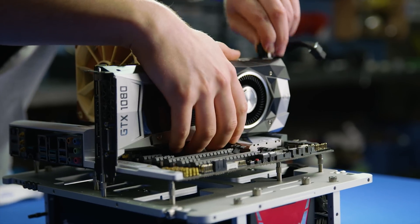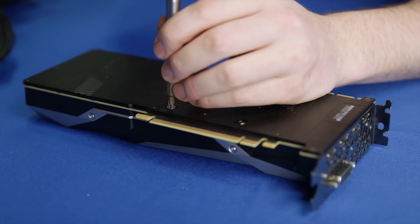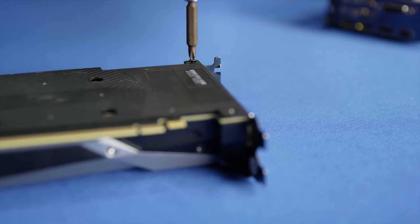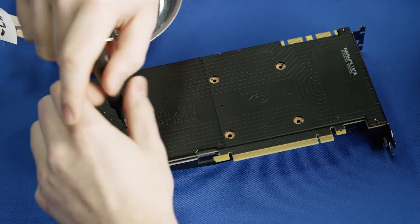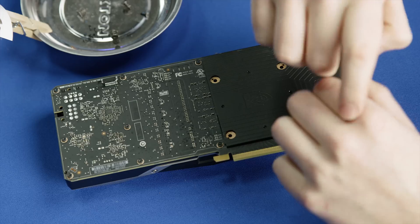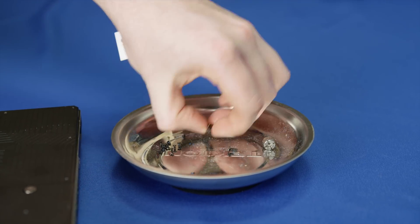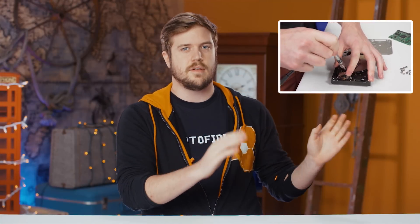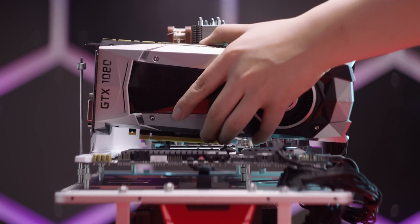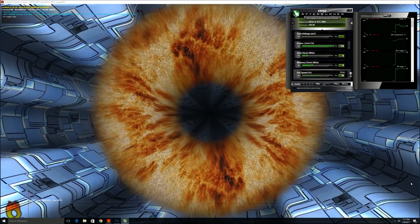Time to take it back off the bench and remove the backplate. Four screws around the GPU, two bigger ones near the I/O, and then there's a ton of tiny, incredibly annoying screws everywhere. Be sure to have a magnetic parts tray — if you don't have one, we have a handy guide on how to make one out of a dead hard drive, because these little devils WILL run away on you. Bench time again. The fuzzy donut is back, and the results: 79 degrees. No change whatsoever.